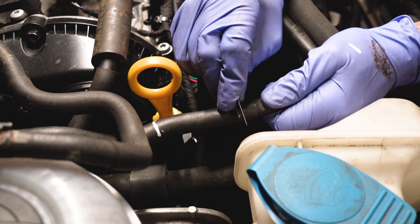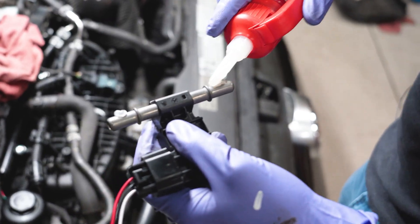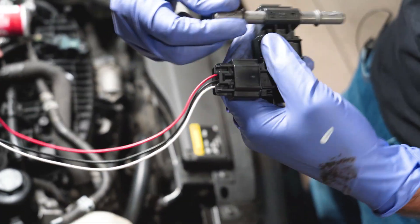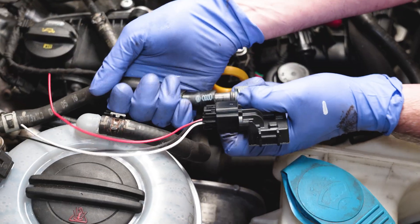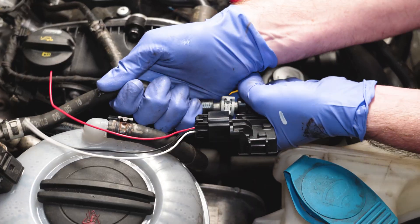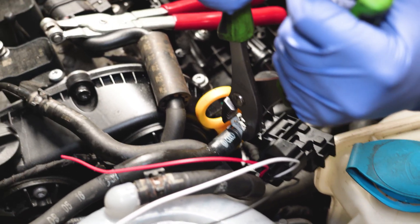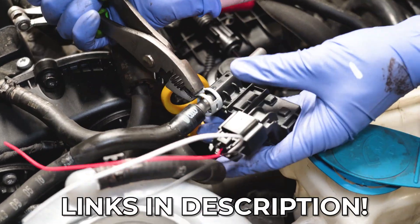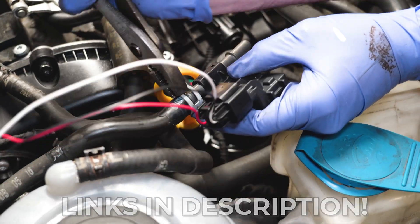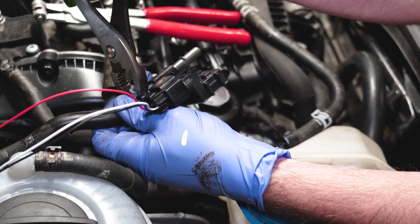I don't have a hose cutter, so I'm using a razor blade and working it back and forth. I thought I let all the fuel out and apparently I didn't. I'm going to lubricate the ends of this because otherwise you're going to have a hard time getting it into that hose. We're going to slide this in place like so. These clamps do not come with the kit so you will need them — you can go buy factory-style clamps or alternatively just put some screw clamps on.